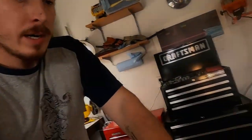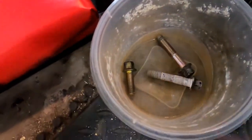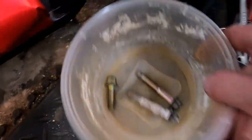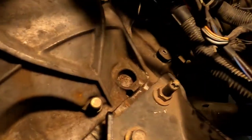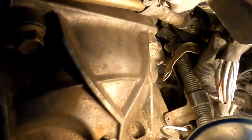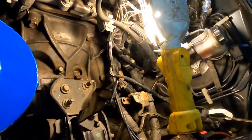We're gonna unbolt those three bolts there. Just, we're gonna break them loose, not unbolt it. We're gonna go back up top and make sure we've got everything disconnected, and we're going to take those bolts off the starter. All right, the starter's off. It was just those three bolts. This one's on the bottom, these two are the top ones that held. I'm gonna put them separate. That held this little bracket, another wire tender bracket. So what's next is